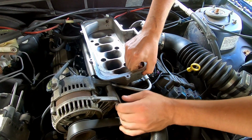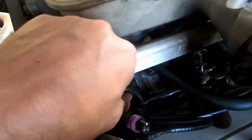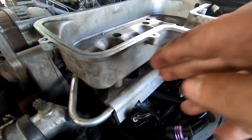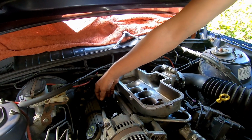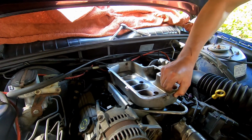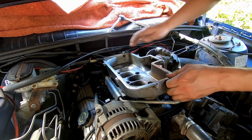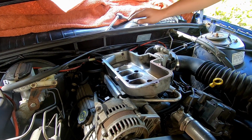Maybe I'm doing something wrong. I'll be right back. There's actually a C-clip in here with every injector to attach it to the rail. So I'm just going to go around and unplug all the injectors. I'm going to have to do it with 2 hands, and undo all the C-clips and then try and lift it up. So as I thought, undoing the C-clips and all that, it'll just lift right up. Not too sure, oh, the injectors come up too. So I was right the first time.